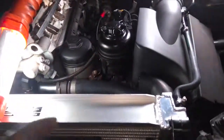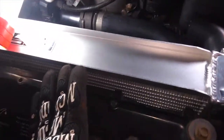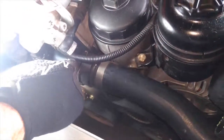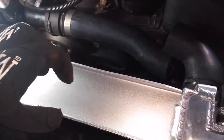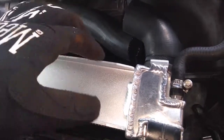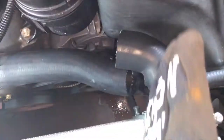I am almost done here, but there seems to be one extra complication with this Mishimoto radiator. I was able to trim down the bumpers on either side and try to get it as close to the original position of the original radiator as possible. That still doesn't resolve the issue back here. This is the upper radiator hose, and as you can see it goes in here to the radiator. This upper radiator hose was originally designed for the OEM BMW radiator, which is thinner. It would work perfectly because it would go around here and snake into the back. But now that we have a thicker radiator, that pushes this connection right here back further. I've just sliced the original radiator hose to show you the difference now that you have a thicker radiator pushing everything back.